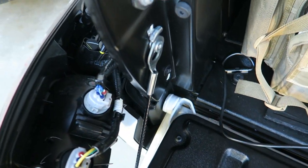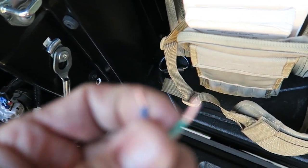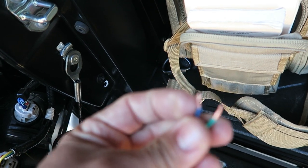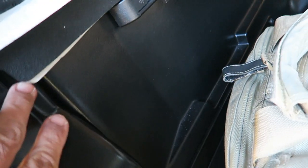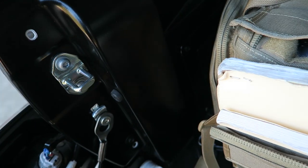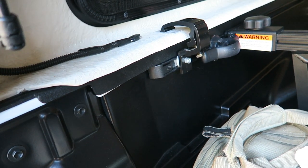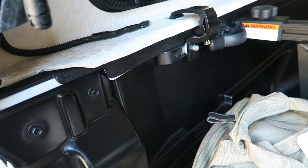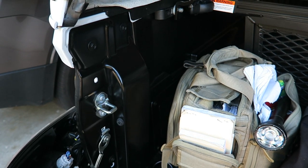Once you've got the ground and hot connections on this end, reconnect your light and secure it back down. Then work with this side — you're going to crimp or solder the ends onto the quick-disconnect plug, run it along the side, plug it in, and your brake light is working. I haven't fully finished yet — I still need to get the connector — but you get the picture. It's very simple. Hope this helps, guys, and I'll see you on the next video!